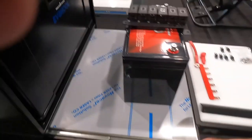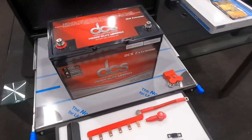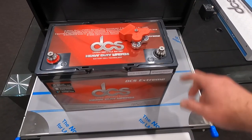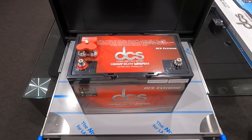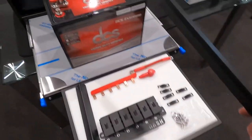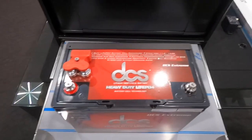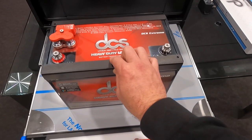All the hardware is included, you just screw it from underneath. We've made it so there's enough clearance underneath so it doesn't touch the battery — there's an air gap there. If you sometimes see the top of a DCS80 ripple, that doesn't matter at all. But if you are using a DCS80 you do have to get additional unilugs, because they don't have a normal pole like a Nissan battery — you'll probably need two of them. If it's a standard factory Nissan battery, don't worry about it. Also in the kit, these bits of angle — because we know how hot these engine bays get and how susceptible they are to melting plastic — sit on there to hold the battery in and maintain even pressure along it.